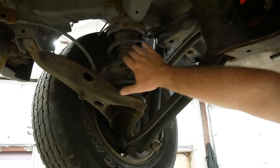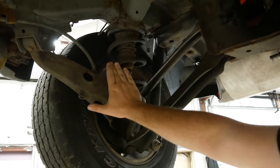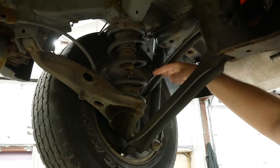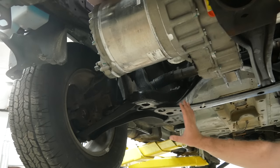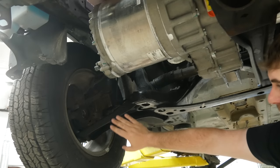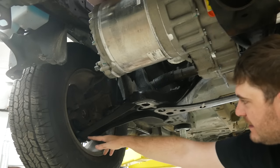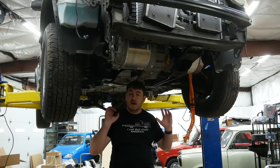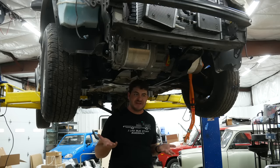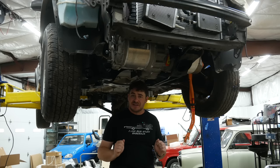Are you worried about breaking or bending the stock suspension components during hard acceleration? 400-plus pound-feet per axle is immense. In the rear there are two pretty spindly arms, but a huge forged arm here. During heavy acceleration, the load is going to transfer through that beefy arm directly into the frame, so I'm not super worried about the rear. In the front I'm less sure — you've got a pretty beefy control arm but it's still bent sheet metal rather than a big forged piece. I might end up boxing it in just for peace of mind. The whole front suspension is also held in by only four bolts. I'm sure it's fine since this Escape was initially front-wheel drive, but it makes me uncomfortable.